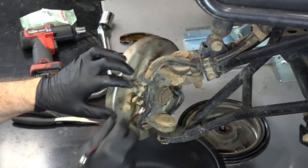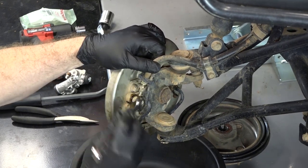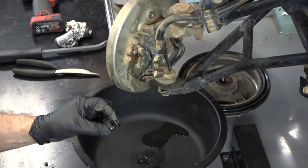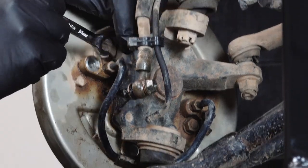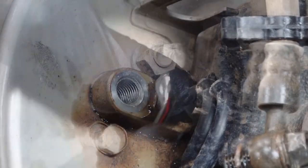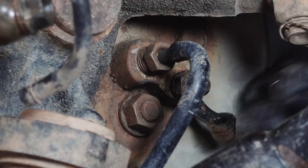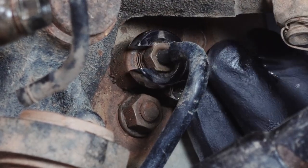Make sure you've got a pan under it because brake fluid is pretty poisonous and you don't want your kids or any small pets to get into it. It's getting close to pinching that breather line, so let's go ahead and slide it up and out of the way. As usual with a banjo bolt, there is a crush washer on either side, so make sure you don't lose those. Now there's a line that goes from one to the other — we just need to take it off. It's much less likely that you'll strip it if you have a line wrench like this. Once you've got it broken loose, to move things along a little bit quicker, you can use a regular 10mm to finish taking it off. Let's reach over and get the other side. To get to it, I'm going to go ahead and pull the bleeder valve out so I've got room to get my wrench in there.